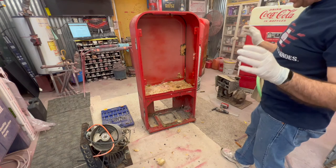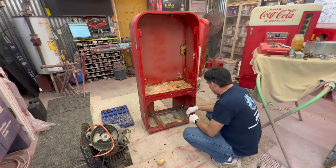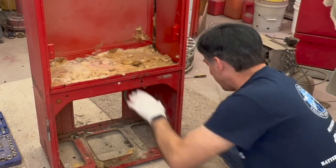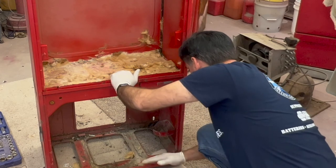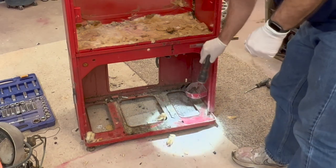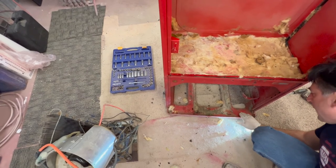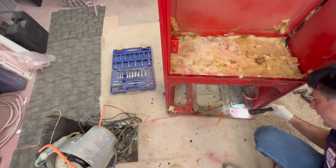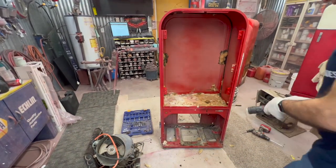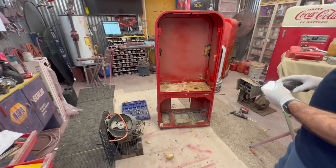If you're going to have this glass beaded and stripped all the way down to bare steel — which I am — there is a faceplate on here. I would definitely take this faceplate off. I showed you the other night where they did a date code, and I'll give you another one here. Over the years I've found the spots on these. This looks like the 12th date of 1951. 1949 was the first production machine, so this is a very early machine. I'll get that serial number looked up. Basically, that is a complete teardown of a Vendo 39.